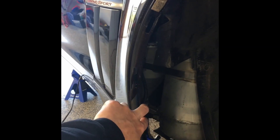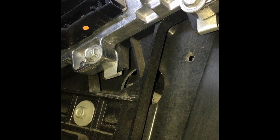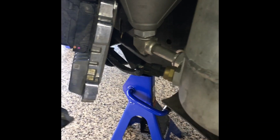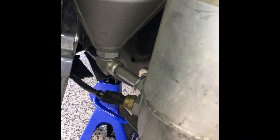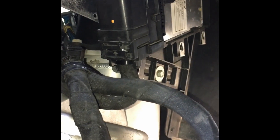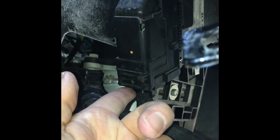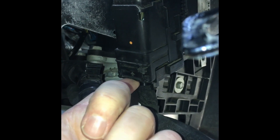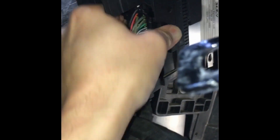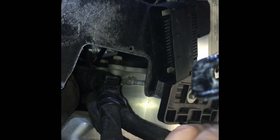With that back bolt removed, the fender has a lot more play to it. Up here are the two 10mm bolts holding on the ECM — go ahead and remove those and let the ECM hang by the wiring harness. With the ECM removed and hanging by the harness, be mindful of this sensor here and try not to bump it. This now exposes the ECM for the MagRIDE control. With the fender pulled back, you have to release the plug for the MagRIDE controller. There's a little tab in the center — just lift up on that and pull it out. It comes out real easy. Be careful not to damage any of the electrical connectors, and just let it hang out of the way.